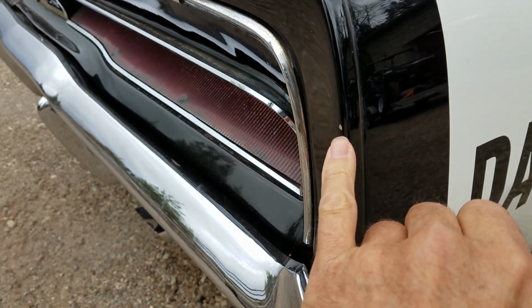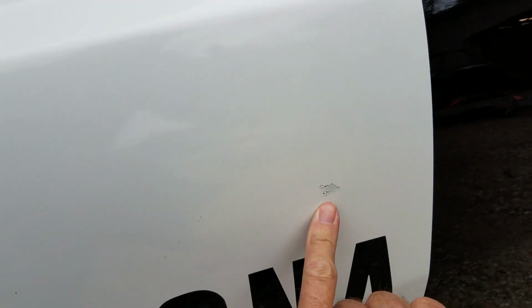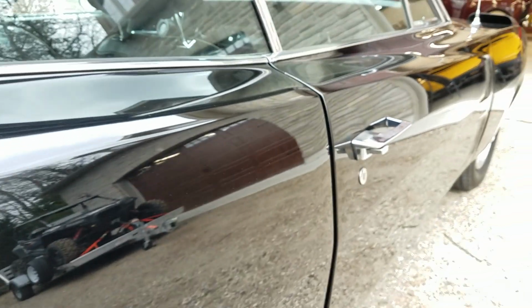The car contains a few small paint chips and touch-ups. All of these are not noted on the exploded view because generally speaking there's not that many. A little bit of stone splash down low behind the tires. A little better shot at that door line, setting out just a bit. The striker maybe could be drawn in a quarter of an inch. But the paint flowed out nicely, no big sags or runs to speak of. There's one on the very bottom of the chin spoiler.